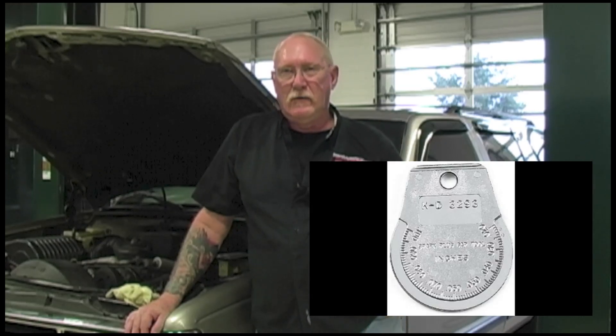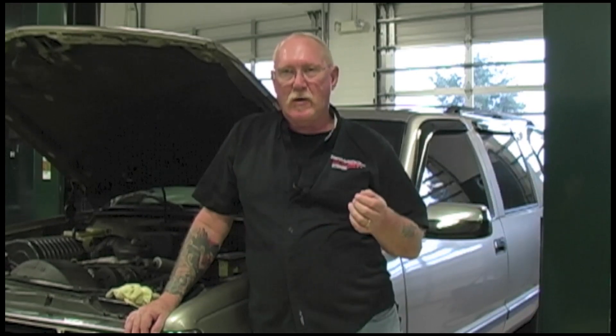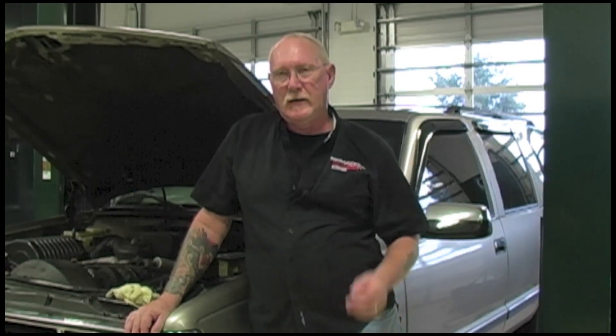Like I said at the beginning, there's a little more to changing a spark plug than just pulling it out and putting a new one back in. Some very common mistakes I know I've been guilty of: number one is checking the gap on the plugs before installing them. We're all told they're pre-gapped in the box, and nine times out of ten it's fine — but it only takes a second to check. Don't use the little ramp tool; use a round wire gauge or spark plug feeler gauges, then carefully make any adjustments. If you damage or break off a precious metal tip, junk the plug and get another one.